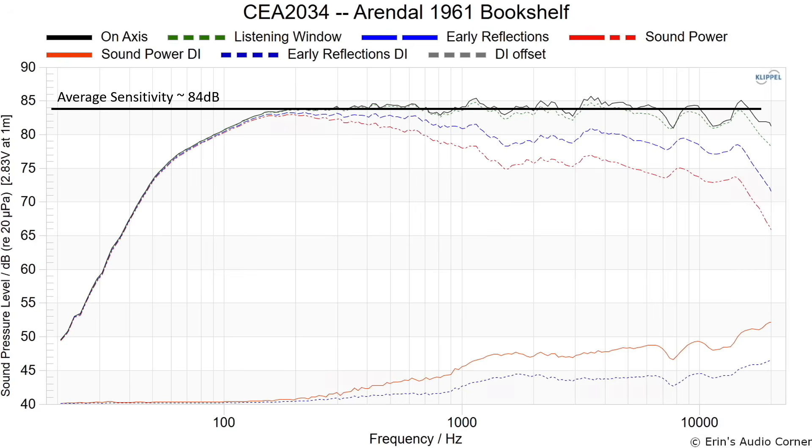The average sensitivity is about 84 dB, which is not great, but with a speaker this small and its ability to get as loud as it can, I think the sensitivity is not a big issue here. This speaker rolls off pretty early on the low end, so you definitely want to pair it with a subwoofer — there's just no doubt. It does have good bass, but if you're wanting low-end output even below 60 or 70 hertz, you're still going to want a subwoofer. I think this speaker is best used as front speakers with a good subwoofer, crossing over maybe as high as 100 hertz, or alternatively as rear surround speakers.